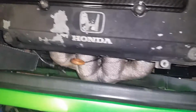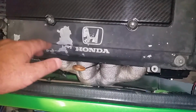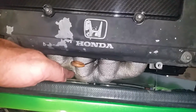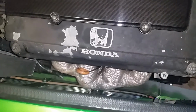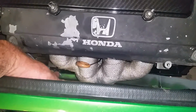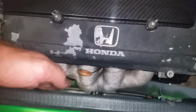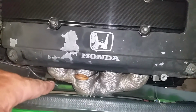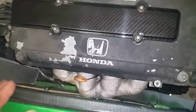The exhaust manifold. So what we've done with the exhaust manifold, it's still the cast manifold that came off the Integra, the 94 Integra the motor came out of, so the manifold didn't quite fit and it touched on the body. So we shaved the mating faces where it mounts to the head and swung it in a little bit. So just by changing a couple of degrees, we swung it away from the body and allowed it to fit into the standard moke, which is pretty cool.